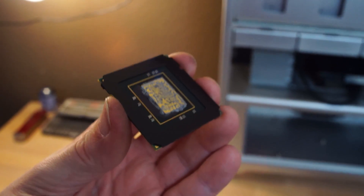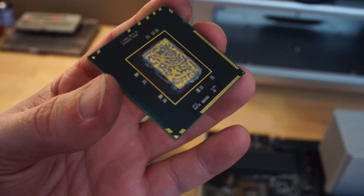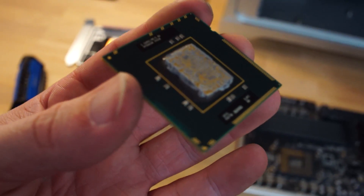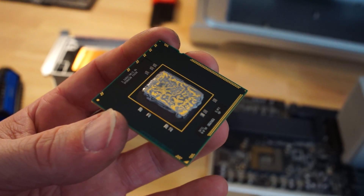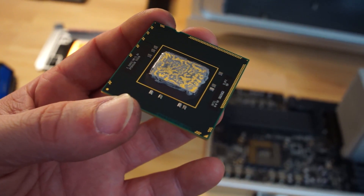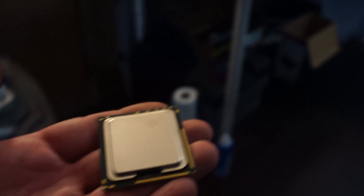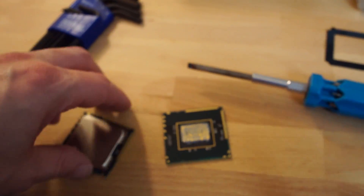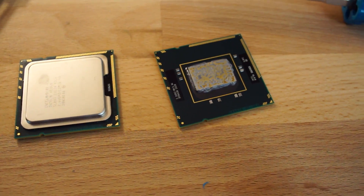Two seconds after I turned the camera off — oddity number two: these CPUs are de-lidded from the factory. The difficult thing about this is when you're tightening back down the heatsink to the motherboard with the CPU underneath, you can over-tighten the heatsink and damage the socket underneath. So a lot of care needs to be done — you do not need to wrench this down. It just has to make contact with the top of the heat spreader on the new chip. Here is my new chip compared to the old chip. Be very careful when tightening these down.